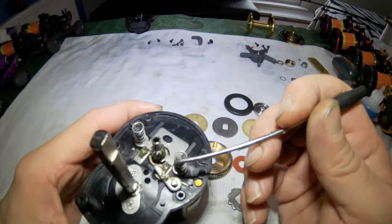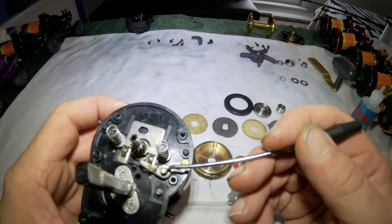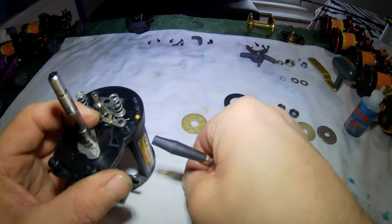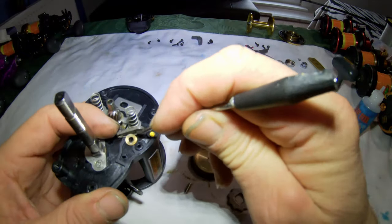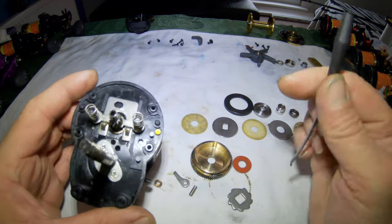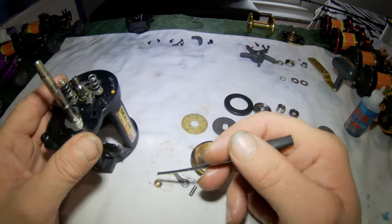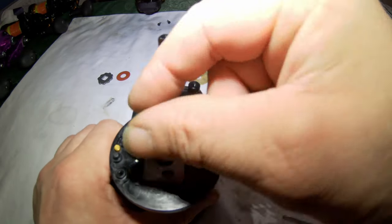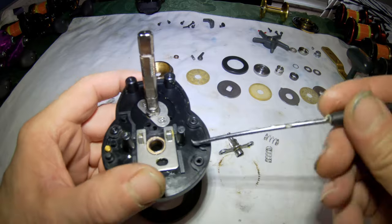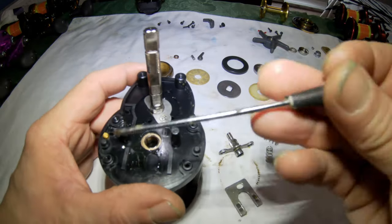The dog leg itself is here. I'm going to take it off and show you how to refit it, as these do spring off and it can be a nightmare to get back. It's in three parts. If you can avoid removing it, leave it where it is. Next, remove the two springs, then remove the pinion and the pinion guard, then remove the plate. Give the housing a clean out.